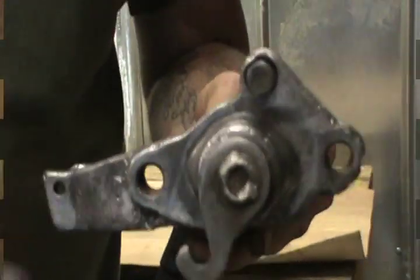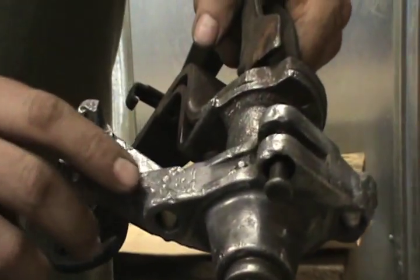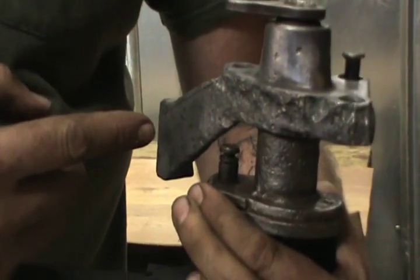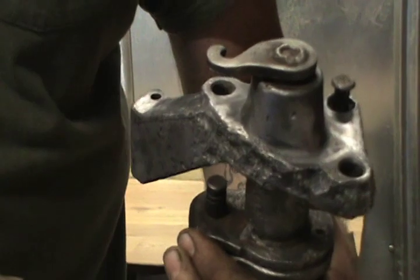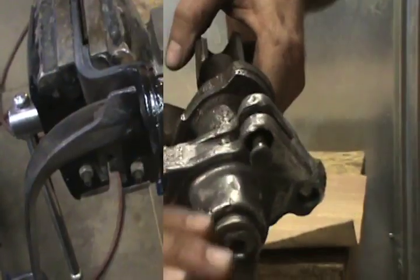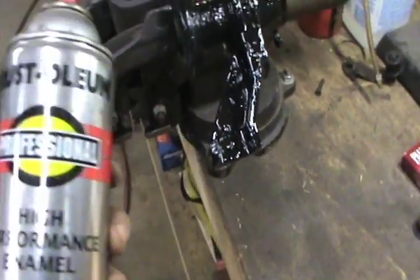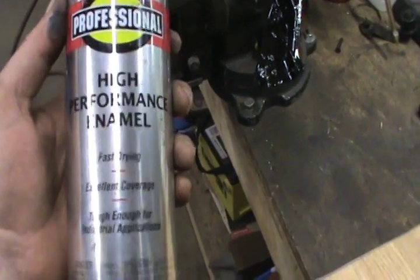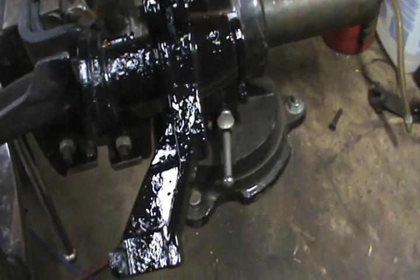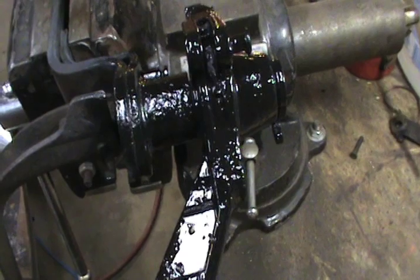I just did a real quick cleanup on this and it was in a little worse shape than I thought. There's a whole lot of pitting here on this aluminum piece. So what I'm gonna do — I just cleaned it up real quick and I'm going to primer it and hit it with some paint. I just want to keep any further damage from this piece. What I'm using here is Rust-Oleum Professional High-Performance Enamel. This stuff is awesome. I keep this in the garage all the time — it dries real quick.